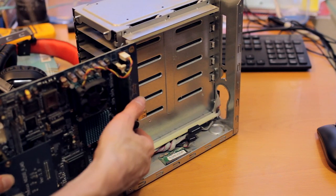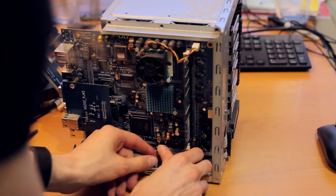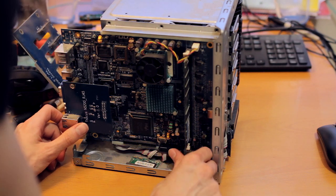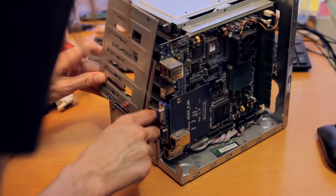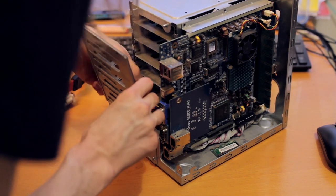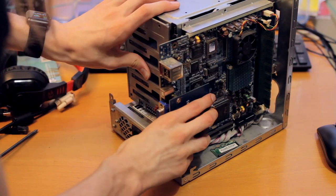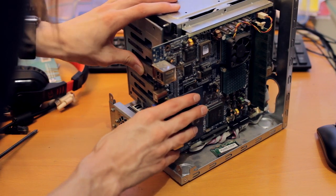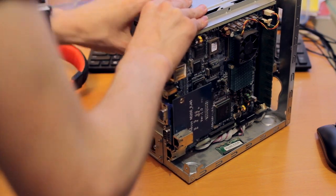The other limitation is it's a 32-bit only system, so that gets rid of most other options. I could technically run some versions of Windows but it might take a bit of hacking because they don't want to run from USB. Also because it's a Pentium 3, it doesn't want to run things like Windows 10 very well — it might run 7 though. So we're pretty much going to say Windows is a non-option, leaving us with just Linux.